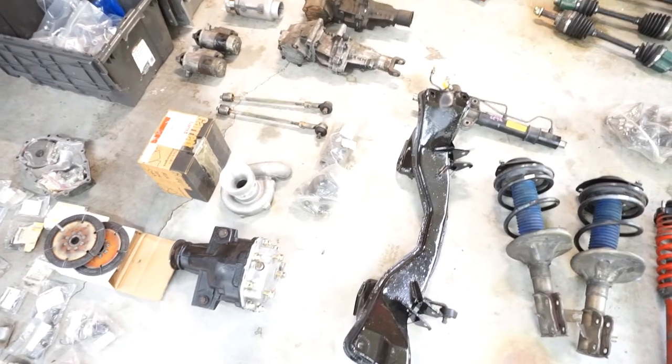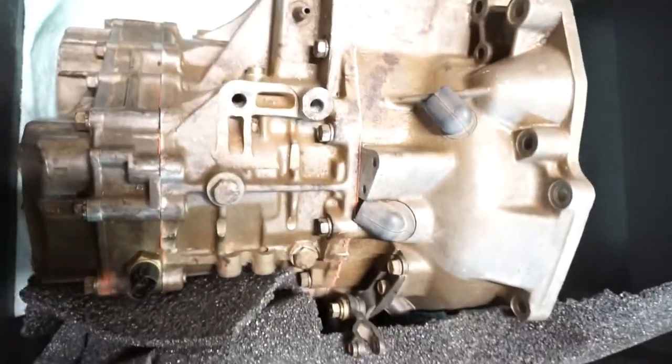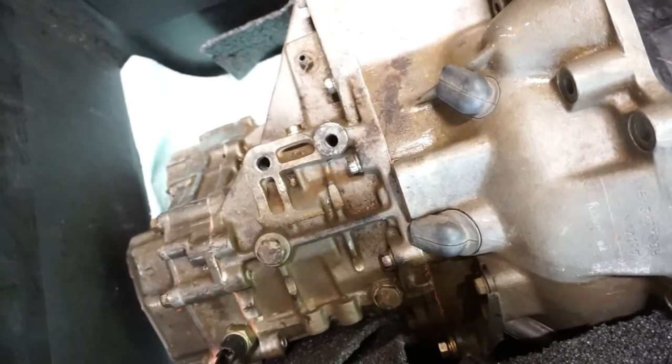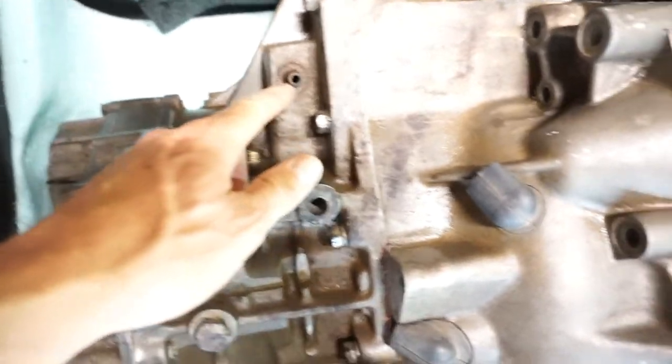I also have a six-bolt block over on an engine stand — it's ready to go, never been honed so it's still standard bore, and could be put into use anytime. Last but definitely not least — the rare stuff. This is a Rally Art dog box with a magnesium case. You can probably tell the hue of green the camera is picking up on. This is a Clubman Group A spec transmission built by Rally Art Germany. It looks a lot like the standard W5M all-wheel drive transmission with a few exceptions: a breather port here, some extra drain ports.